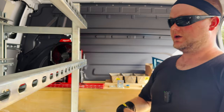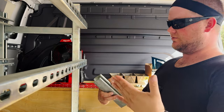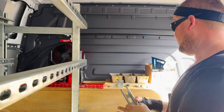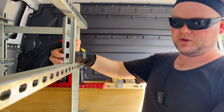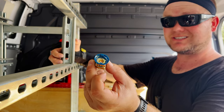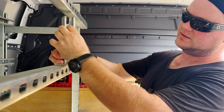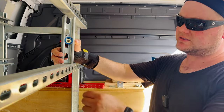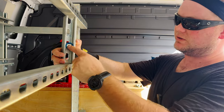After making those connections, we needed to attach vertical components to the van. Anytime we're using the open end of the strut, we use these special nuts — they have a little plastic insert and also spring-loaded ones at about the same price. You can slide them in or insert them and turn to the right so they stay in place. You can move them wherever you need, making it modular so you can adjust a shelf up or down on the fly.